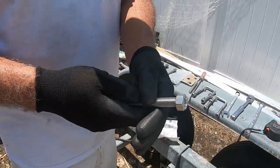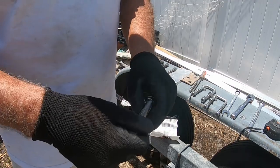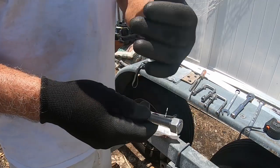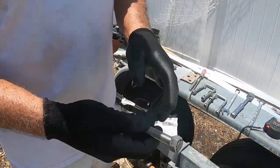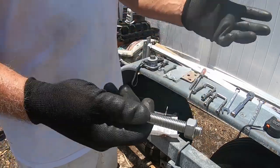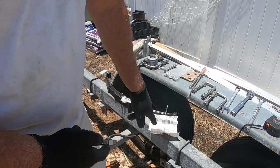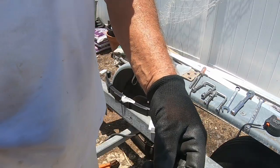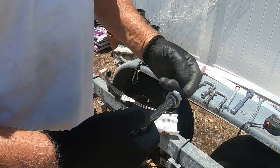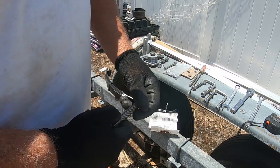And I had another one that same thing. The nut was frozen on there and it was not coming off, and it didn't matter what I did to it. I ended up leaving the bolt in place, and I wanted to turn it around, but I left the bolt in place and cut off the end, which solved my problem anyway, so I didn't have to replace that. But when I came out here to take off the spring, that nut was not coming off of there. I locked the head of the bolt, which was on the outside, in place,